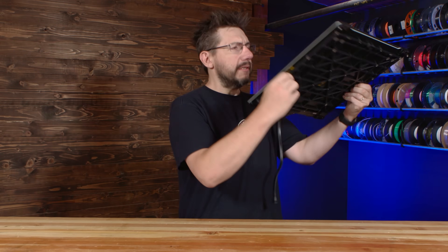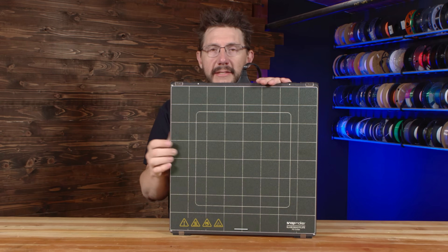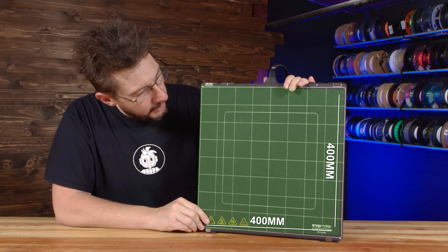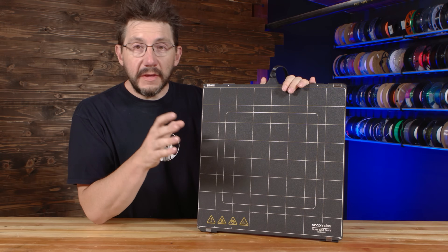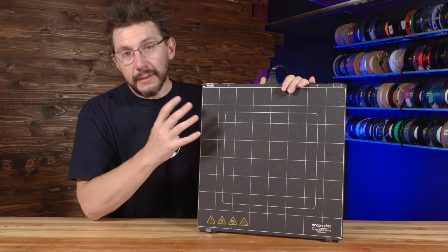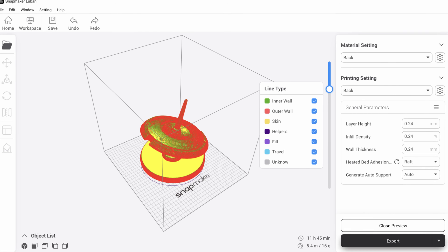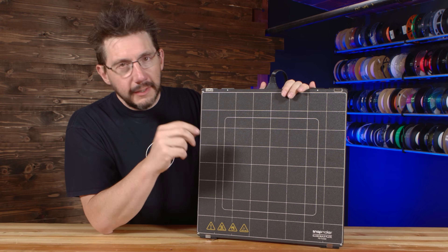The first of the three I want to talk about is 3D printing. This is the work surface for 3D printing, otherwise known as the print bed, and it does have a 400 by 400 outer zone. That line denotes an inner zone of 260 by 260. It's a two-zone heated build plate — Snapmaker gets it to 110°C in the 260 by 260 zone, and the larger zone can get up to 80°C. Their slicing software Luban, when slicing a model that fits within that 260 by 260 center area, just won't heat the external area, saving you a few pennies.